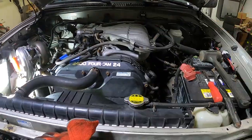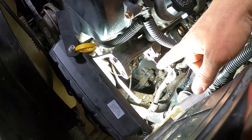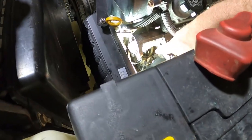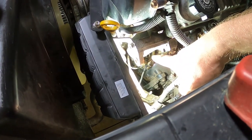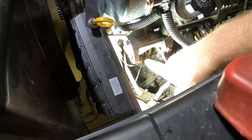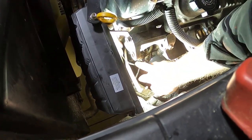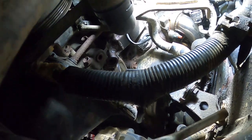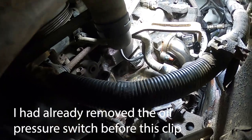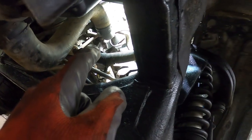Now we're going to start with oiling the turbo. The alternator goes right here — I already removed it. You can see the oil filter opening, the threaded port right there. I took that off, and then the oil pressure switch is right there. Getting underneath the truck — the port's right there by the tip of my finger. That's where the oil pressure sensor threads in; I did already remove it.